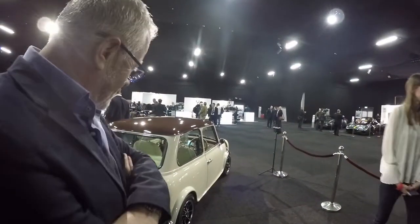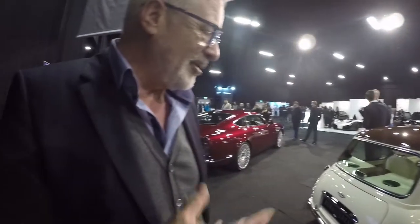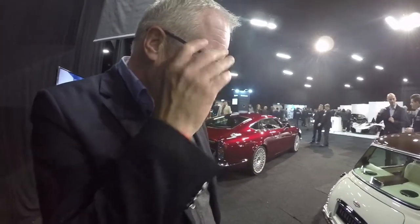So what have you re-engineered, remastered on the Mini? A hell of a lot. If we start with the outside, we take a brand new body shell and we then de-seam it completely. The de-seaming, as you probably know, means reinforcing the inside of the car and putting the strength back into the body shell on the inside rather than the outside. We then rework every panel so that it's absolutely perfect. That's a lot of work. There is a lot of work.